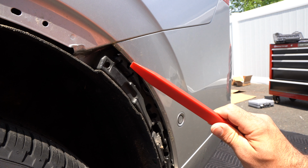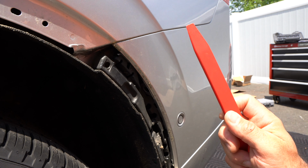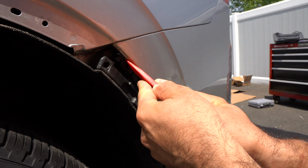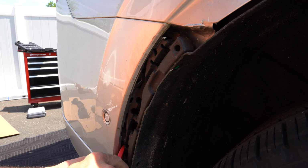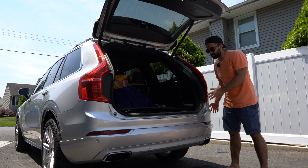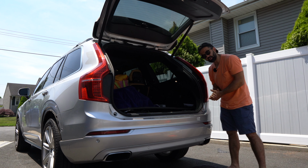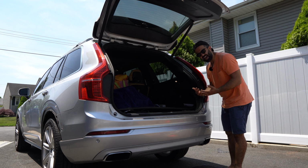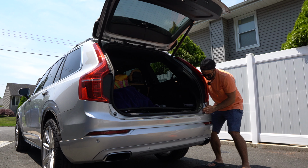Next is we're going to remove the three plastic clips holding the bumper together. And to do so, you need some sort of a plastic trim removal tool. I'm gonna link everything in the description. The next step is pulling the whole bumper cover out, but not completely removing it, because we have to disconnect some wiring that's here. So you wanna extend it maybe half a foot away from the car and disconnect the wiring.